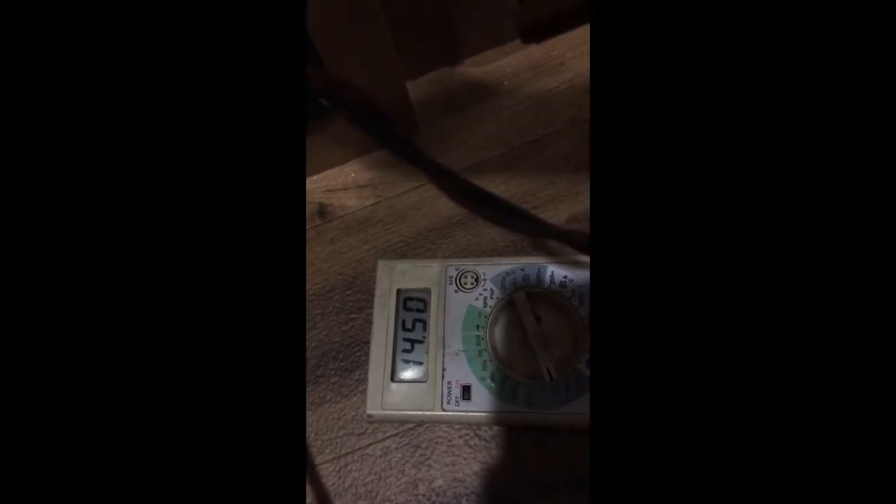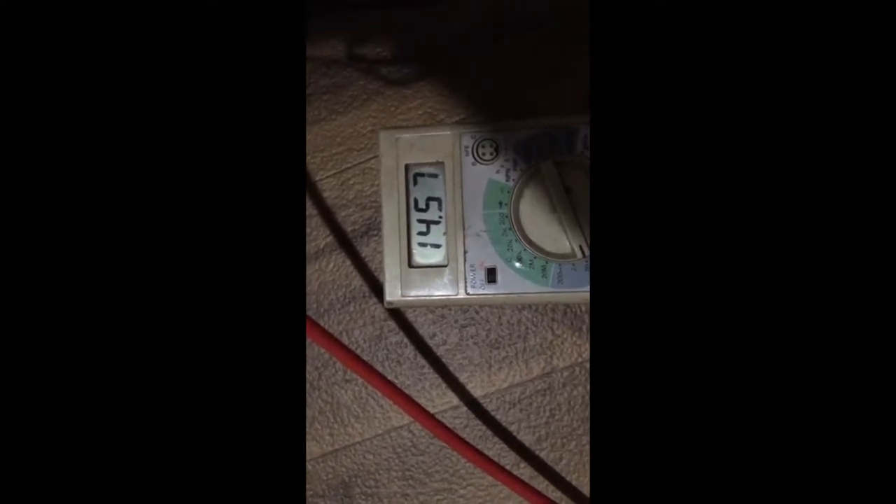I'm not sure when this thing's going to kick out — whether the batteries outside have to reach 14.4. At one hour 30 minutes: 32 amps, so it's tapered off a little. Batteries at 14.2 volts. At the converter: 14.56 at the charge port.